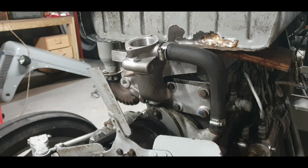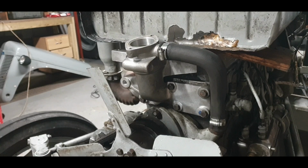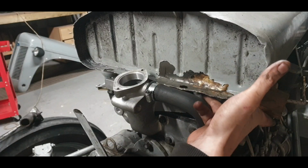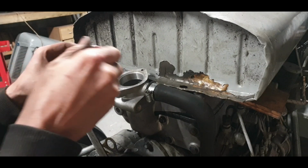Right, so next bit is our thermostat housing. So I'm just going to give that a quick rub on the sandpaper like I always do, just to make sure it's clean. Bit of Indian head, gasket, and drop in the thermostat housing, and hopefully then we'll be ready to go. Now we'll have to find out whether this tank has a leak. It looks like there's a weep under there, yeah. So we'll be taking them off and we'll be doing that.